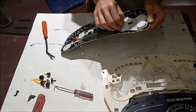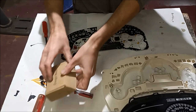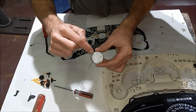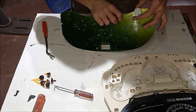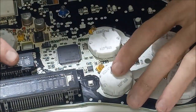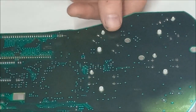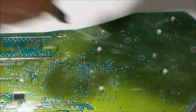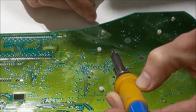This gauge here is the one giving us troubles. We have our replacement motor here and this is just soldered in with four points, so we're going to desolder the back here and then put the new one in. Flip it over and there are four solder joints that need to be heated up.